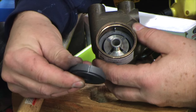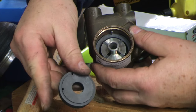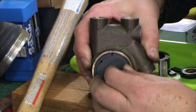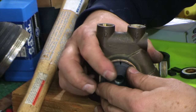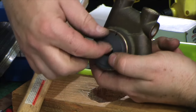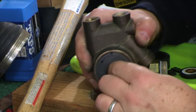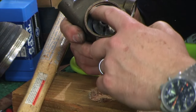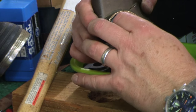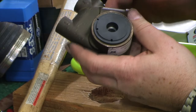This again has that alignment groove. The gouges or cutouts go towards the pump — that's the outside towards the front cover. You want to try and align this up on the pin. If you have that outside mark, it's a lot easier to get it just where you want. If the pin's not lined up, don't force it or you'll crack the cover.